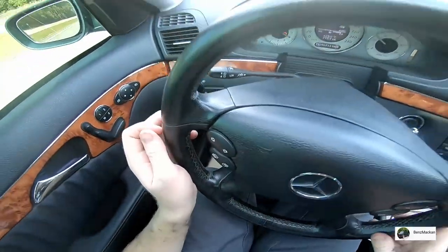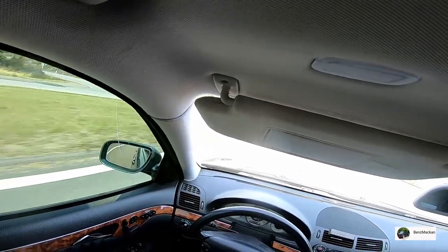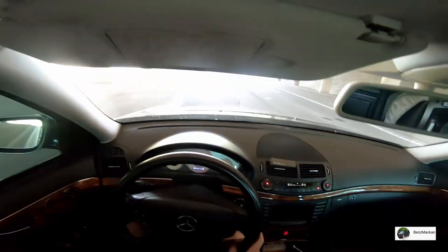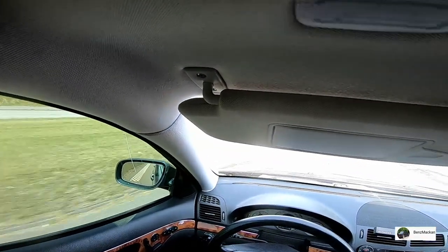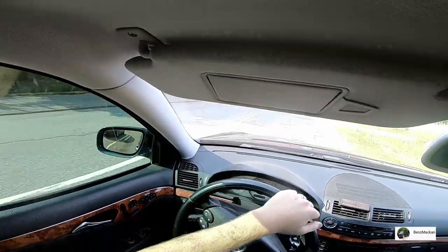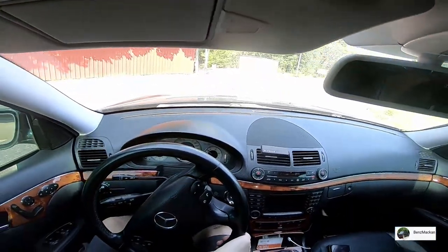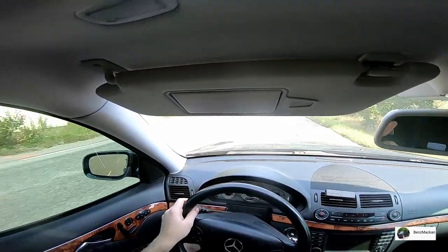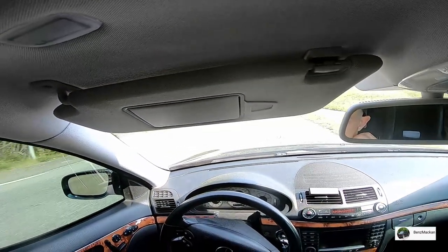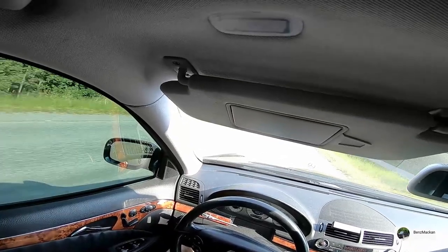As you can see, I have the check engine light on, and I've checked the codes, and it states boost pressure too low or not reached. I think it was something like that. And that fault code occurred at the same time as the engine mount collapsed. So either due to the vibration, one of the solder joints in the turbo actuator came loose. I've done some research on the internet, and apparently that's a common issue. Or one of the boost pipes or boost hoses has a small, tiny leak in it. However, that will be on the to-do list. For now it will work fine.